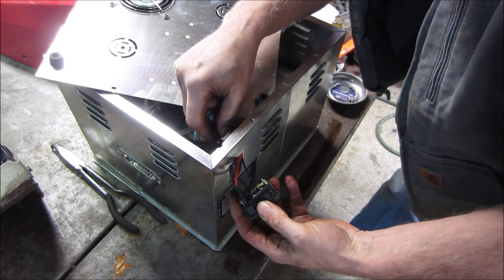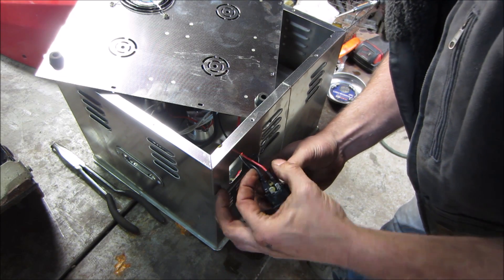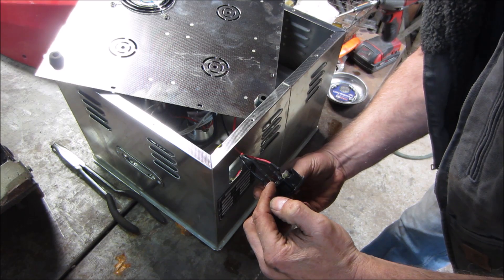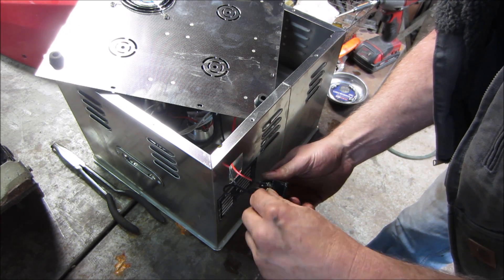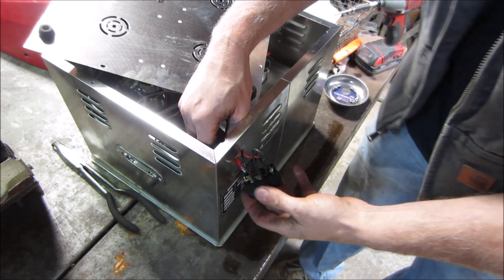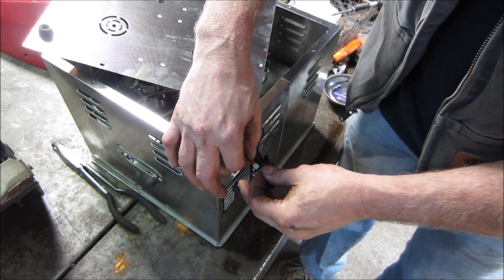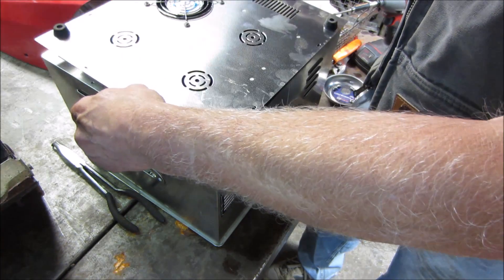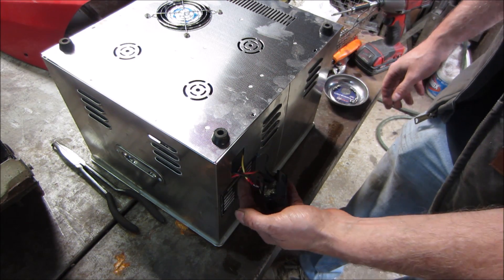That wire just came off the lower level. Let's get a test light and see if we have power going through these two terminals. If not, we're going to bypass that and put it right to the power coming in. This switch seems to have another set of terminals which might be opposite. Actually, I went to put the ground back on and it's really sloppy — I have a feeling maybe it just vibrated itself loose and the switch might be fine. Let's put power to it.